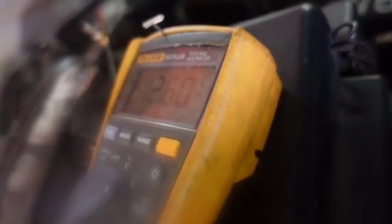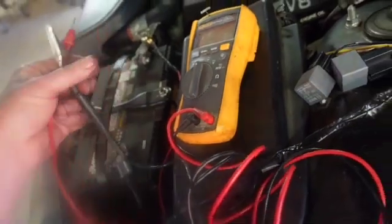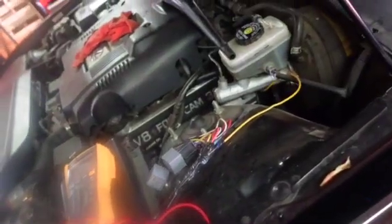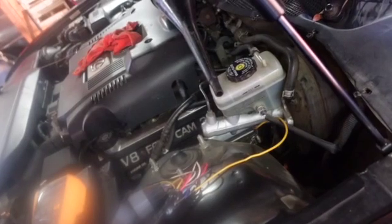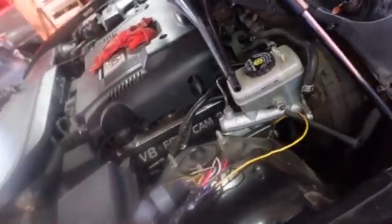So you're gonna put like 1.5 quarts in? I don't know, Chief. I felt like I overfilled it based on the dipstick. I may just go 1 3/4. Okay. Well, you know, I learned recently, I learned this on the 64 Bonneville, that the low mark on the dipstick is a pint. It's not a quart. That's how, you know, most people put a quart in if they're on the low mark, and that's too much.